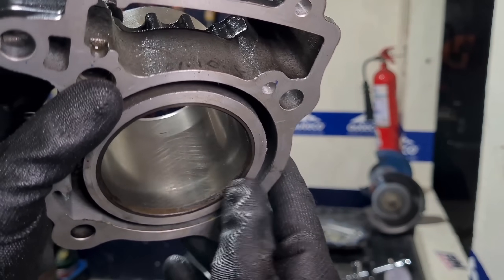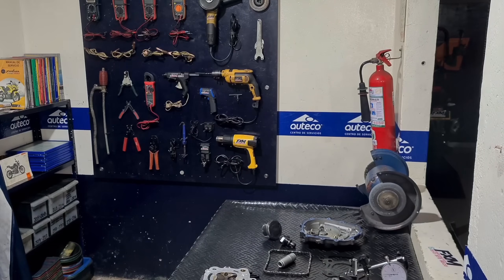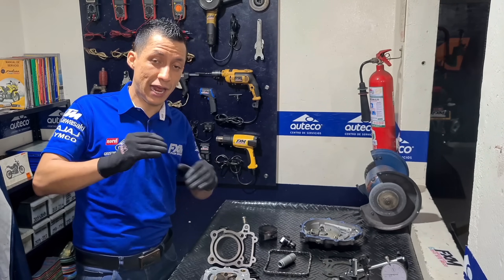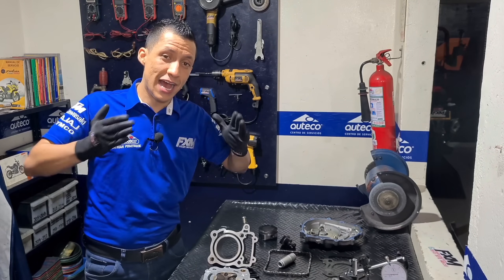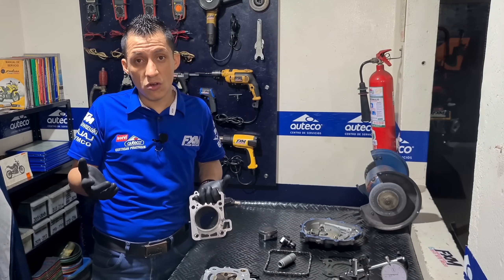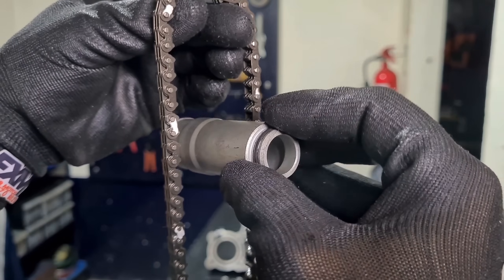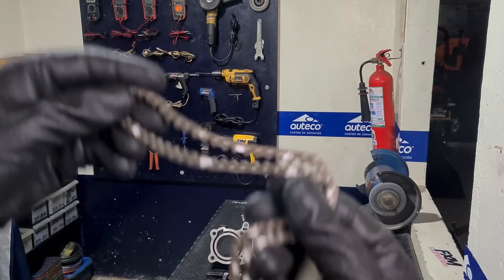This cylinder cannot be re-bored. I've been asked in other videos why we don't re-bore cylinders — for motorcycles of this RPM type it doesn't work. We have to replace the cylinder. This fault can be caused by two things: cold starts, which are very dangerous (I've discussed in other videos the importance of waiting for the engine to reach ideal working temperature), and two, not changing the air filter, oil, and oil filter in time. In this case the air filter was quite dirty. This chain guide helps with early diagnosis of chain wear — a worn chain can rub the guide and eventually cause wear, but in this case it's in good condition.